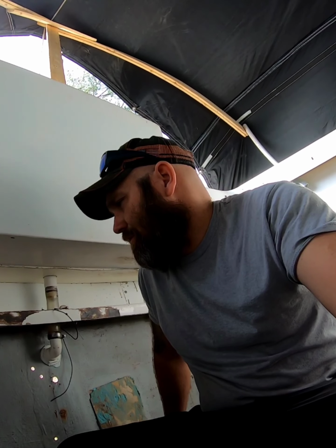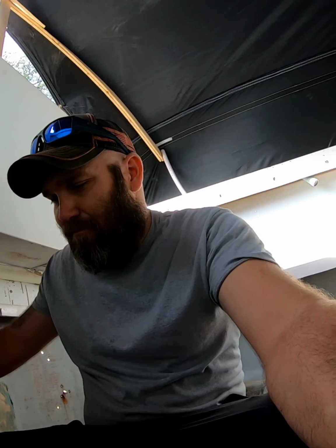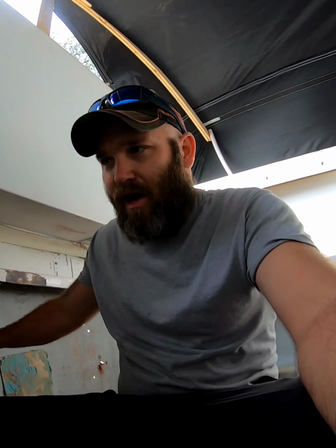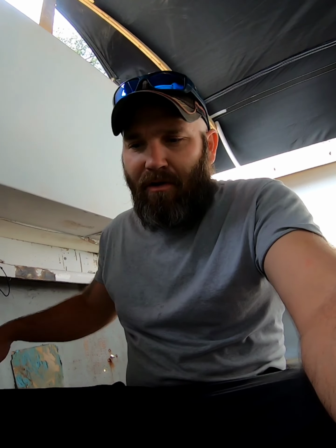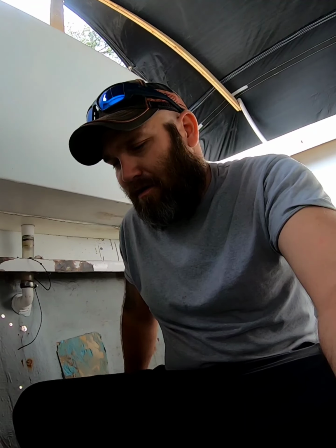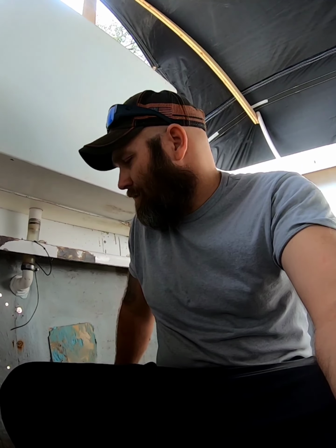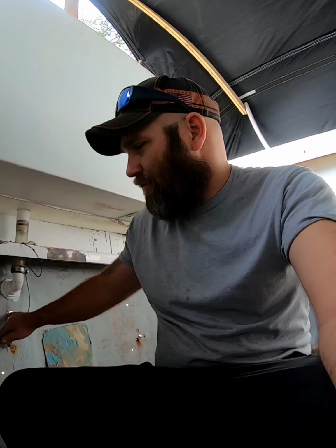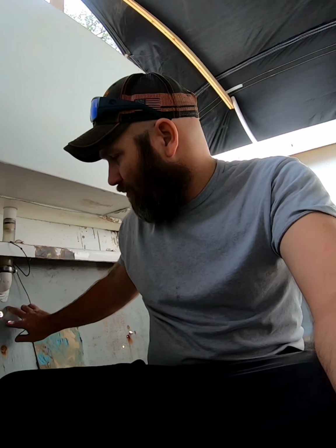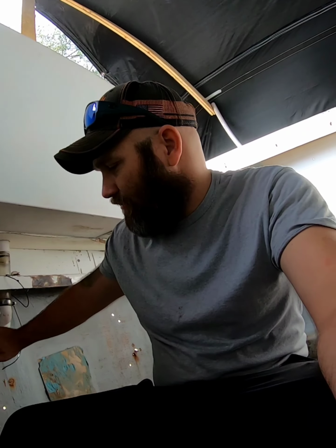And on the outside, to keep it as smooth as possible, because I'm not wanting to put any fiberglass on the outside, other than where I'm fixing spots and then taper it back with some fairing compound and have it ready for paint, I want to use chop strand matting on the outside just to keep it smooth. So that explained, you know, fill with polyester structural putty, chop strand matting around the hole to hold the patch in, and then 1708 on top of it.